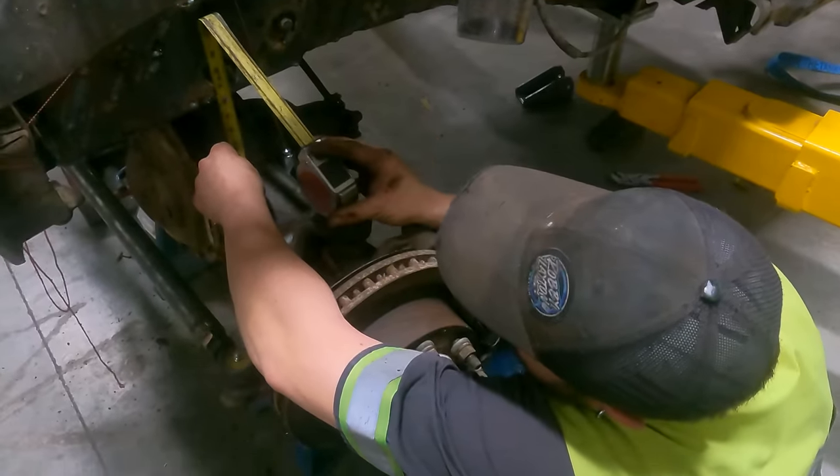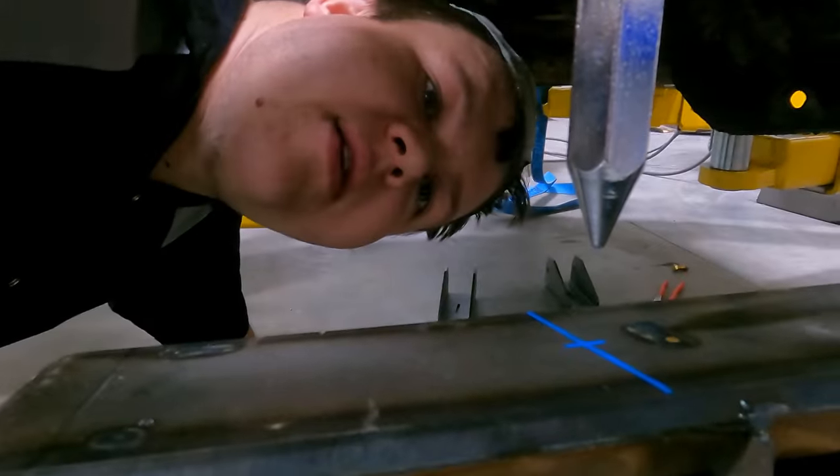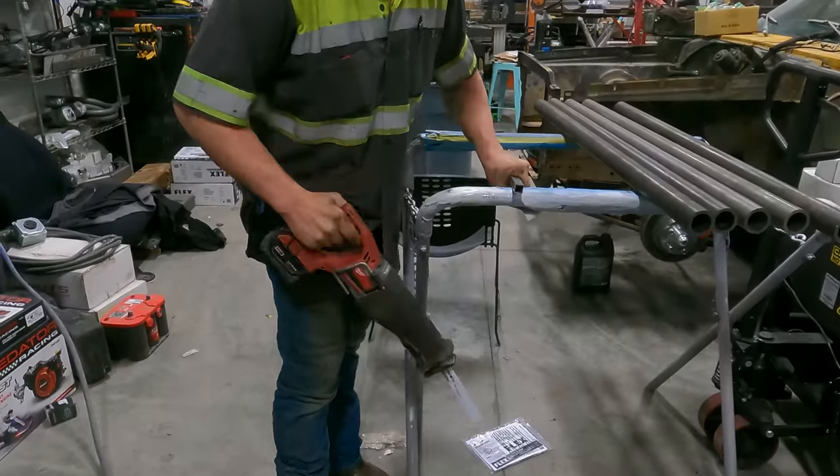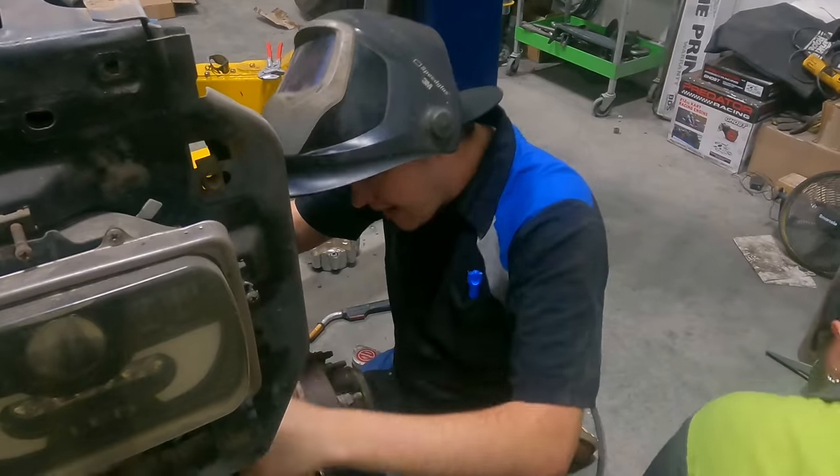There's six inches. We're gonna measure six inches — we are dead center. We're welding this bad boy in place and that's all there is to it. So we've got both sides welded. We're at 89.9 degrees, so we're almost 90 on the pinion.